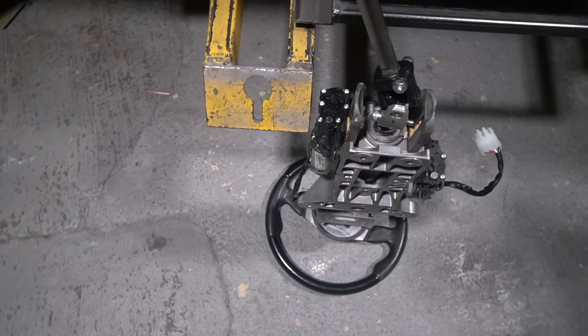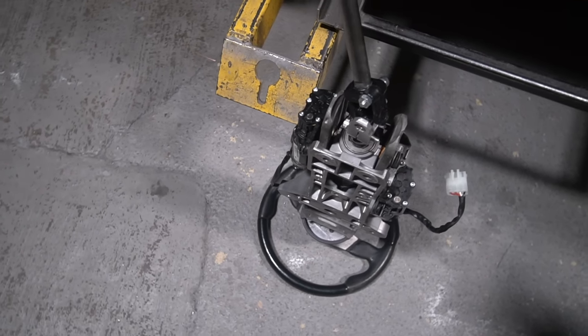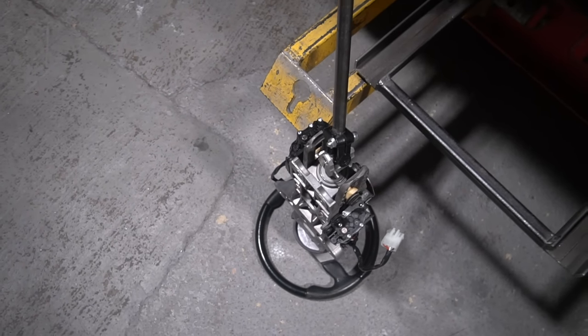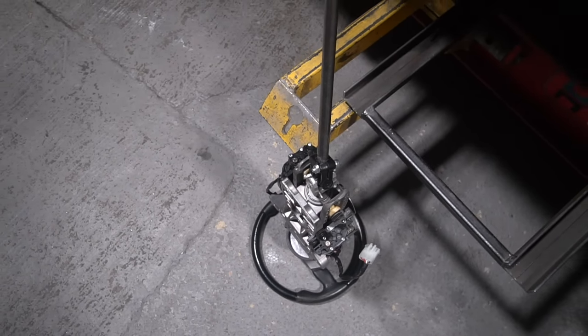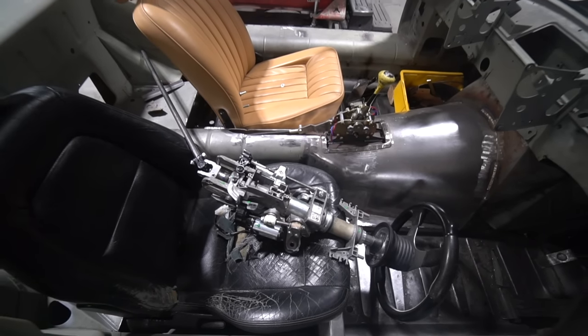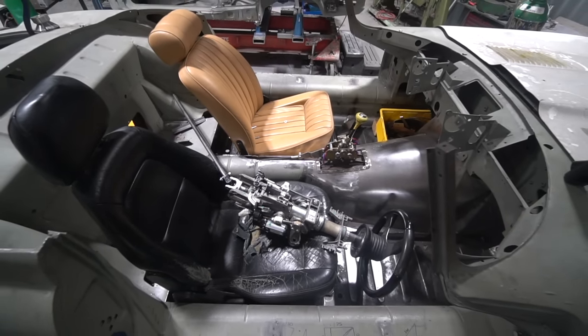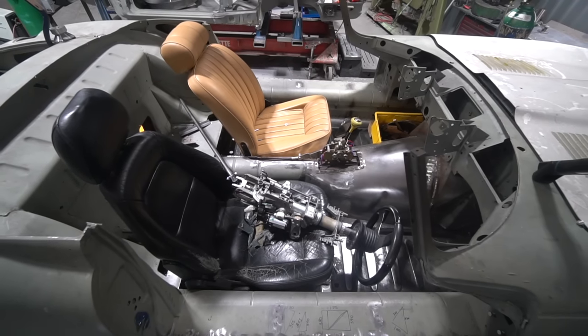So it didn't really make sense to have to be completely at one side of your adjustment in his favoured position. So we're doing some modifications, which Sam started on that bulkhead front dash assembly there, so we can get the steering column a little bit higher. And what we'll probably aim for is having it in the owner's ideal position when it's in the centre of its adjustment. So that's that prong of attack.